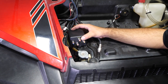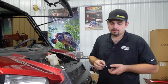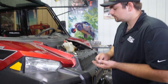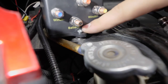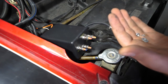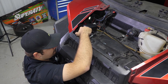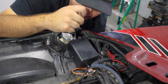That way when we sit our control box down, it lines up with the two outermost holes, and our control box sits straight. We're going to get in our winch hardware kit and find the two long Allen headed screws. We'll take one, pop it through the front hole, then go to the back side and do the same exact thing. Then we'll grab two small flat washers, lock washers, and nuts, come from the bottom side, get our hardware installed, and fully tighten the box to the machine.